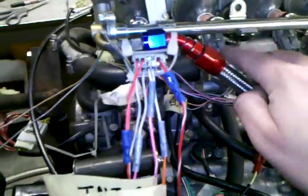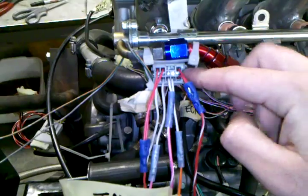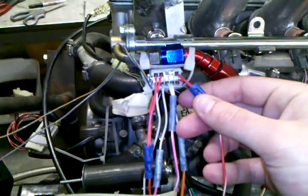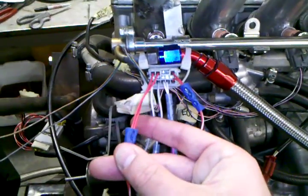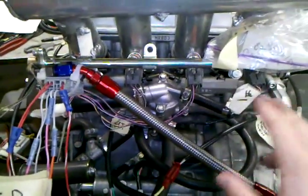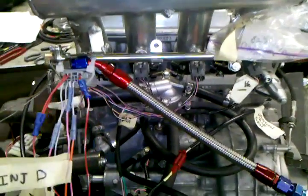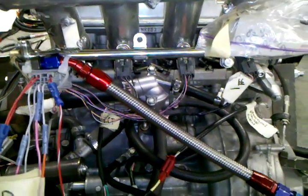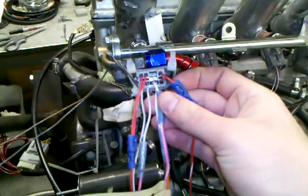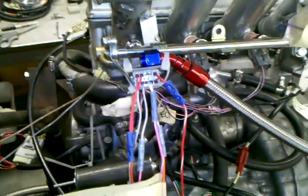You can see that each of these wires are wired in parallel upon exiting this connector — this is for cylinders 1 and 2, and these are for the injectors coming out of cylinders 3 and 4. What's uncommon about all four injectors is that they each have their own signal wires. I've wired one wire going to each injector and they exit from this connector, and they each need to be provided their own signal — the input signal from the Megasquirt expander card.